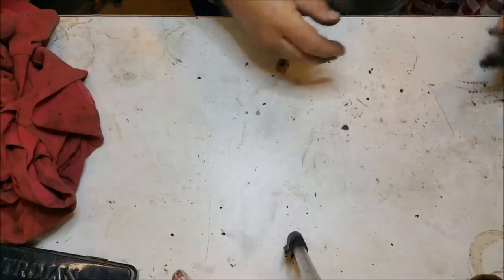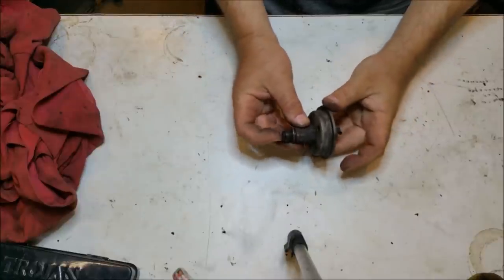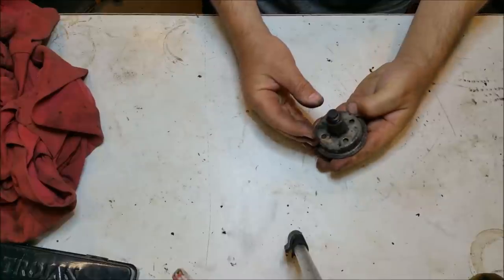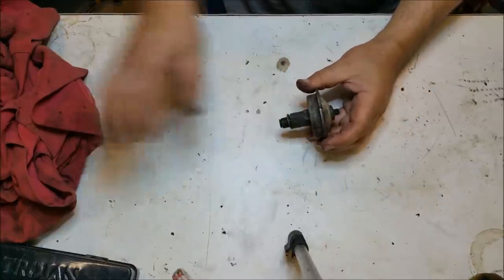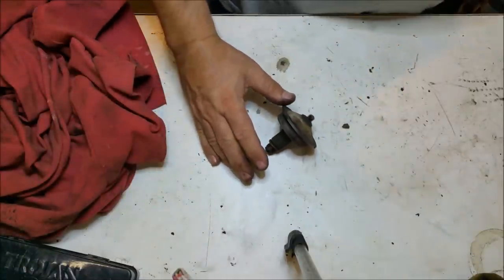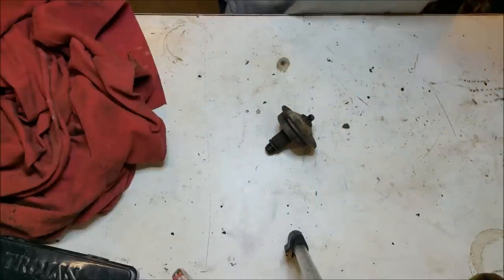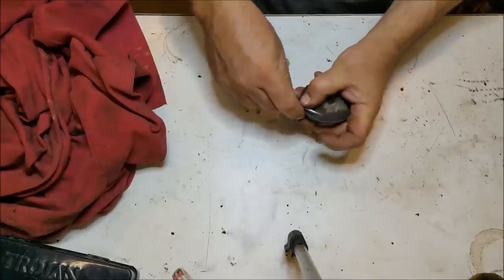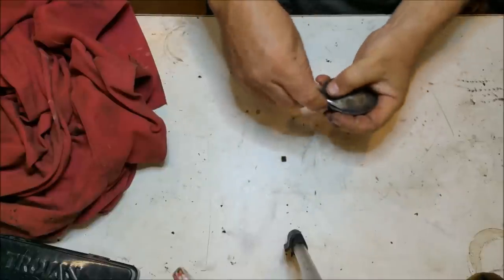The humble decompressor. This one's not too bad. You push the pin tool in, stick your finger over there and it stays in. You let the vacuum go and it goes off. Very easy to get into. If I can find my screwdriver, where'd I put it? It must be in this tools here. Right. I'm just going to take them off like that, put my finger over the end, and those clips will come off.